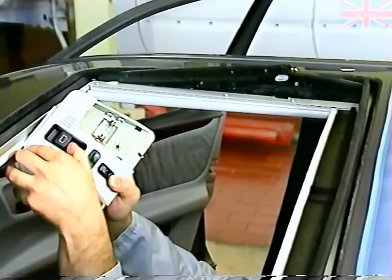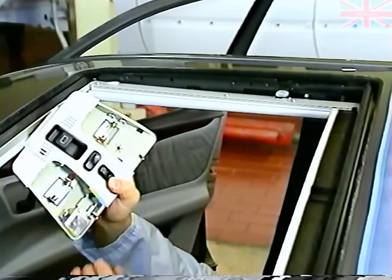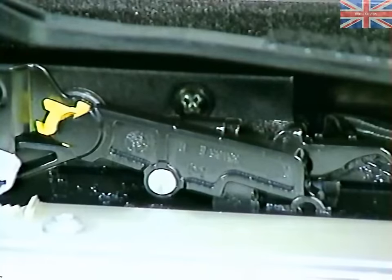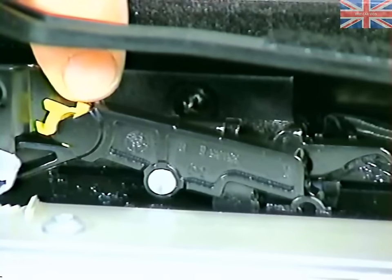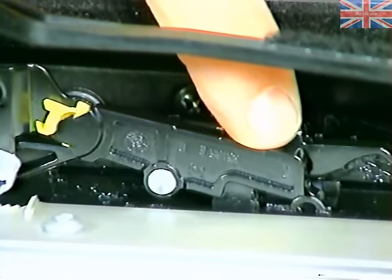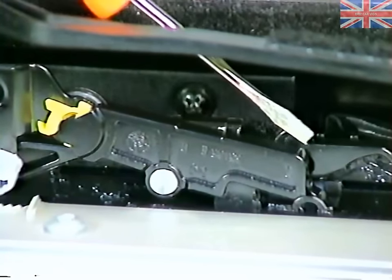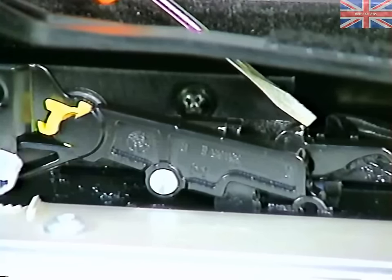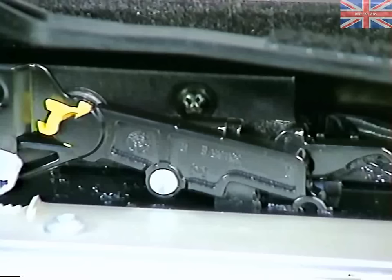After the motor is installed, the tilt brackets are lowered to the roof closed position to confirm that the left and right cables are aligned equally. This is done by observing the relative position of the two parts of the tilt bracket at this point, and then confirming that the tilt bracket on the other side is aligned the same. If the alignment is not the same, an error was made during the synchronizing process explained previously.